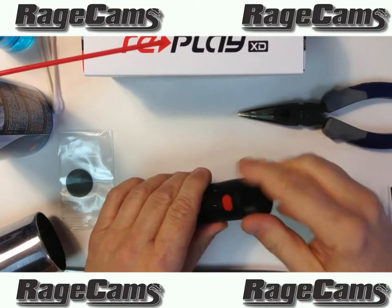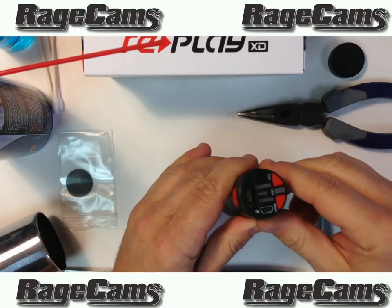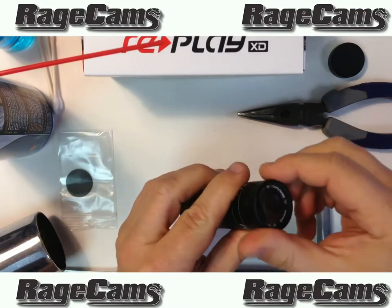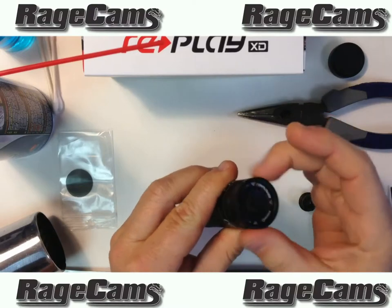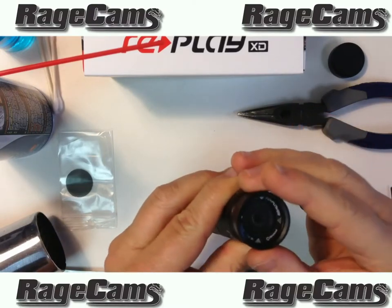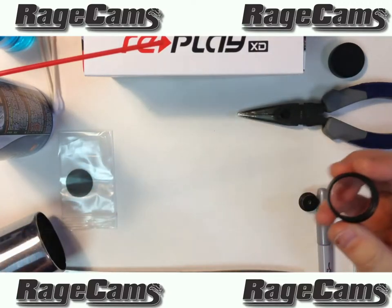Remove the rear cap first because we're going to have to use the HDMI output after we're done with this to align your lens just perfect. Focus it up. You screw out the lens top there, and this cap right here gives you access to the actual physical lens.